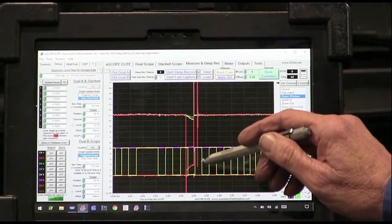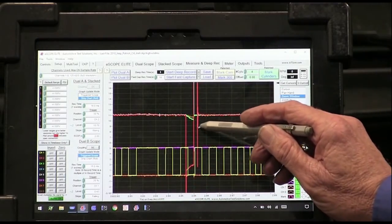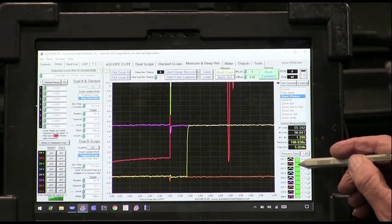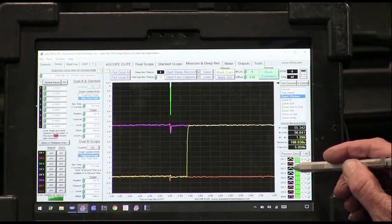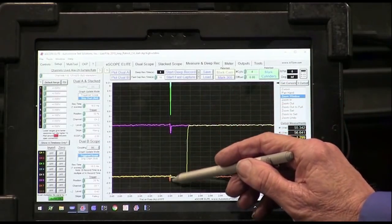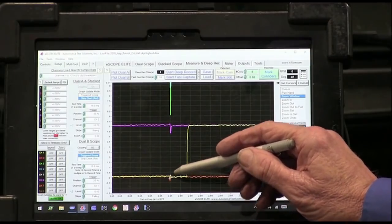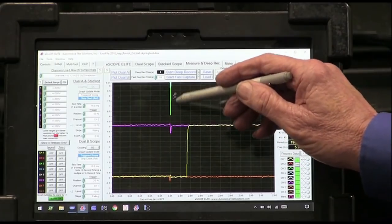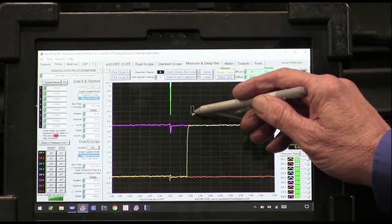We fired the number one coil, and right after that coil fired, we had a problem. So let's shut that off. We'll turn that off. Do you see how the 5-volt took a hit here? We took a hit on the ground leg, and this is the injector, or this is the other coil fire here off of 12 volts.